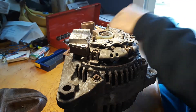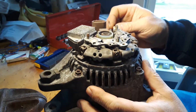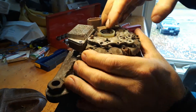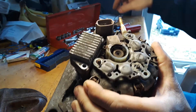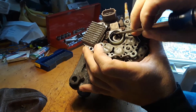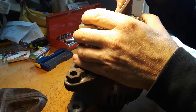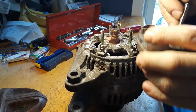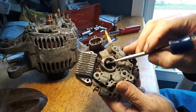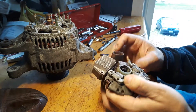One of the things I encourage if you're new to doing this sort of thing — sometimes remembering how stuff goes back together can be difficult. You can always take pictures with your cell phone. Now this whole thing's going to come out of here, and right up in here there's a brush. I don't want that brush to go flying off, so I'm going to lift that up and hold it in with the screwdriver. I just don't want that to spring out.